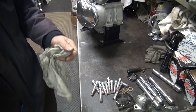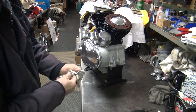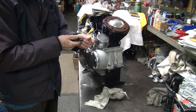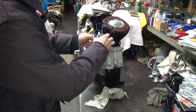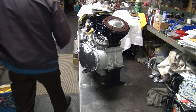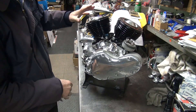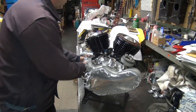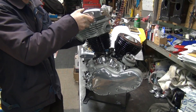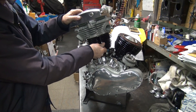This trigger cover is going to be in the way so we've got to take it off. The timing is already set so I have to deal with that. A little bit more access to get up in here to tighten it down. I start with the rear head because it's easier. I'm going to put a gasket on and stick it up on there.